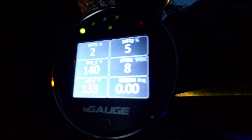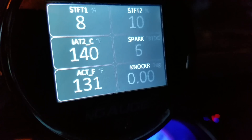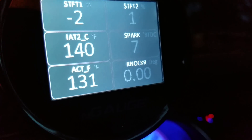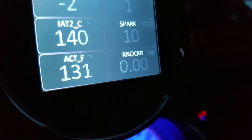After the ice tank was installed, I went on the road and flogged the crap out of the car. I wanted to get the blower temperatures really high — I was successful getting them up to 140. Air charge temp is 131, hood's down, car's been idling a bit. IAT2 blower temps are 140. Short term fuel trims are pretty damn tight on the donkey dick P-mass. So what I'm going to do is put ice in it.